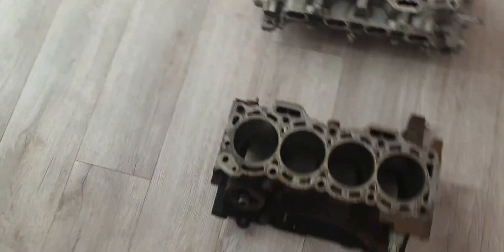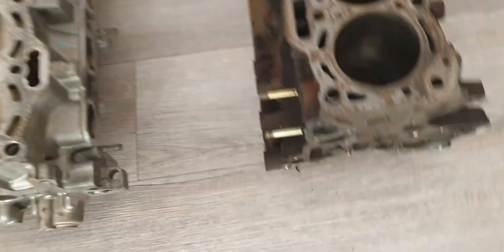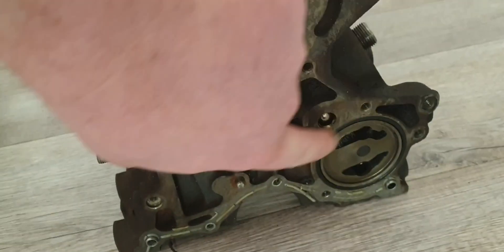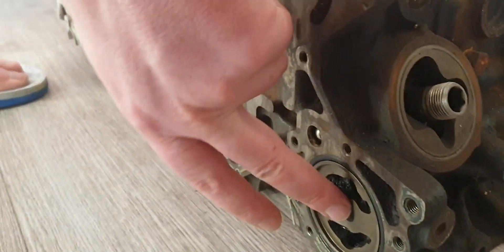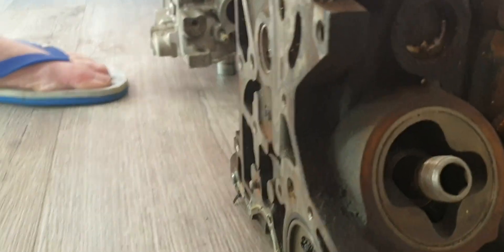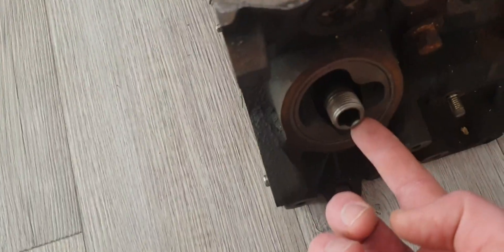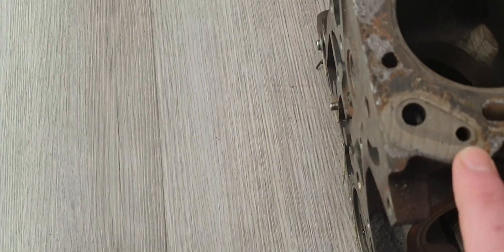I just had to rotate that block. So yeah, the oil system — how does that all come into play? Let's start over here. The oil pump is situated over here. The inlet and the outlet are over here. Just travel around the block — go straight from the pump location to where the oil filter will go. I had to look a little bit more because I couldn't work out where the oil would go from this point. I actually figured it out: oil pump, oil filter, and then oil gallery.